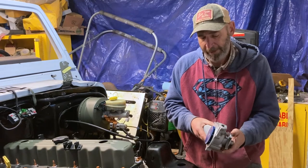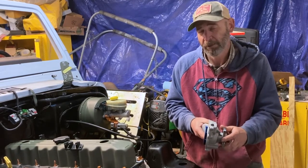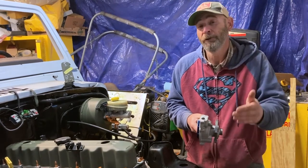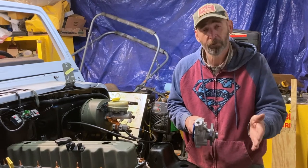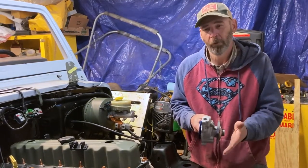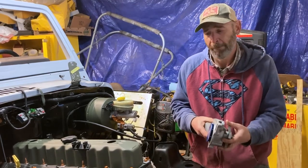Because they take more time and use better materials for the guts, you're also putting less stress and wear on your motor. It doesn't take as much force to spin this blade, and because of that you're saving — or rather not using — that horsepower you'd normally consume. That's why a lot of race car guys go to electric fans; they don't run the clutch fan or pulley systems because anything on your pulley takes away from horsepower. I don't want to rob power when I don't have to.